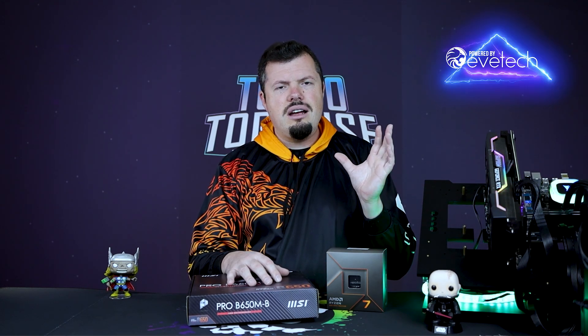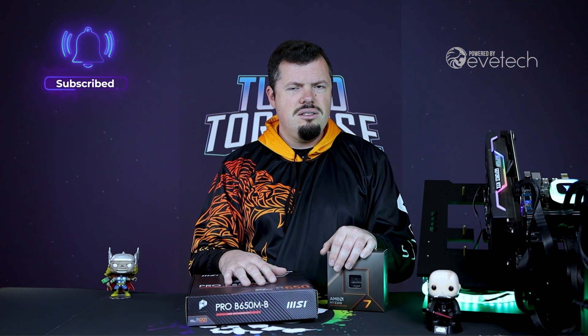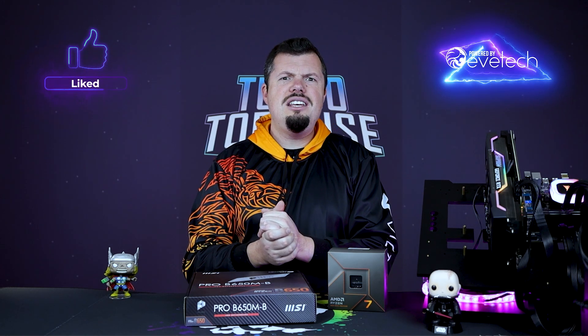Very easy to keep cool as well. Don't rely on the stock cooler for this chip. The 8400F or 8300F with the stock cooler should be okay, but for the 8700F I'd suggest maybe not even an H100 — just get yourself a good tower cooler like the Deepcool AK400 or a Hyper 212 level cooler. A good tower cooler on this with 5600MHz RAM is going to go quick fast. That is all I have for you on the 8700F. If you've enjoyed this review, please give it a like and subscribe, and I will see you on the flip side.